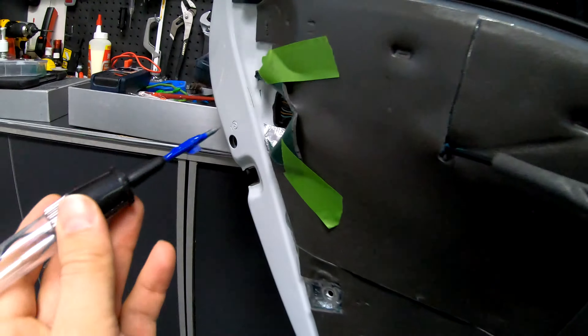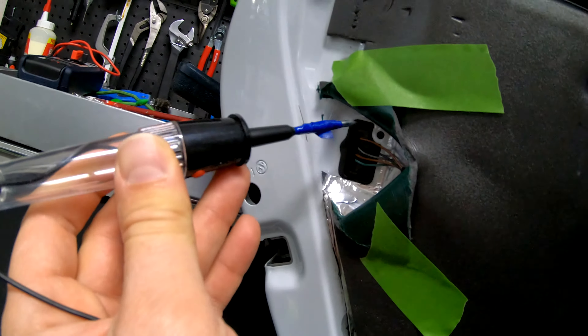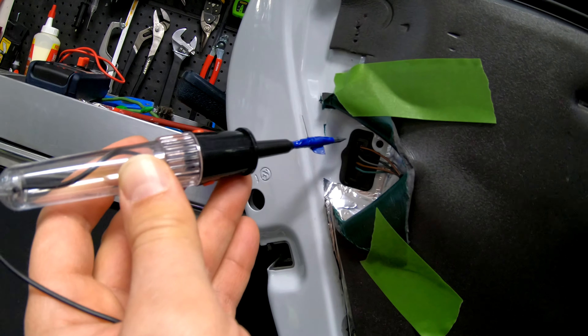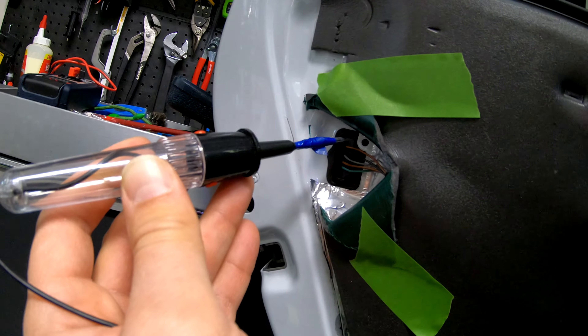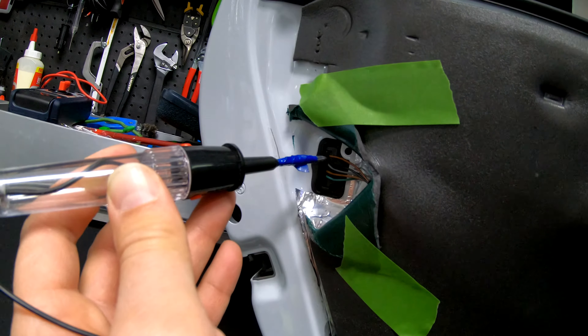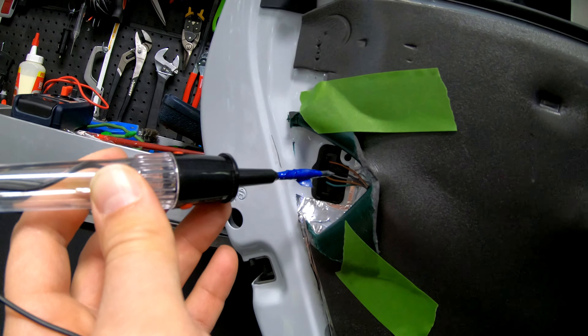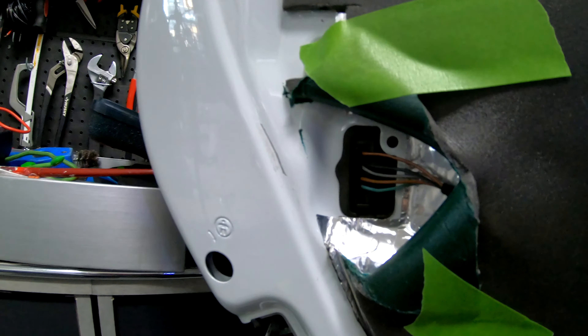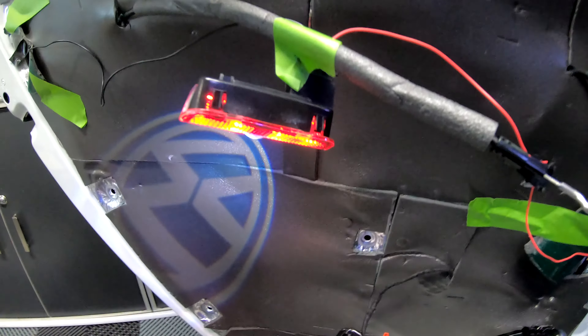When the light can't turn off, you have to do it with the door open and then the door shut. Whichever wire gives you the light only when the door is open — that's your connection. It doesn't have to be continuous, because if it's continuous forever, that bulb will stay on forever. You need the wire that turns off when the door is closed and turns on when the door is open. In my case, for the 2018 Passat GT, I'm connected to the black and gray wire, second from the top — light is on with door open, and off when the door is closed. It's working — awesome!